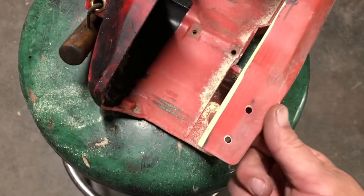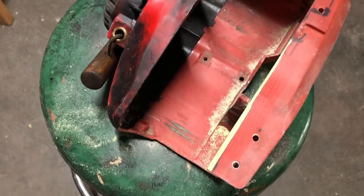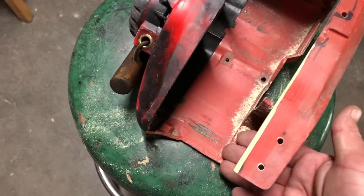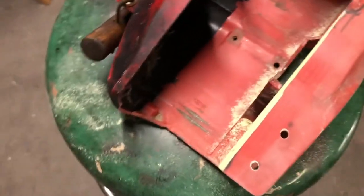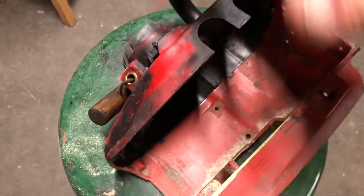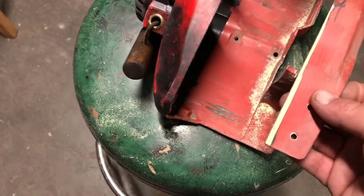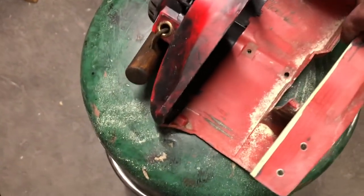When you're doing your little metal under-piece, you can bring it all the way out so it's held in better with the bolts or screws. Remember you need a lot of clearance down here — if you're doing the block piece you'll have to readjust your block size or the panel underneath your block to make sure it's at the right height and still fits. You don't want to really change your block piece, just the little panel that's with it. You put your panel on, glue it and clamp it, or bolt it down. I do suggest the bolt technique but still add some glue so you can take those bolts in and out for mock-ups and final installation.